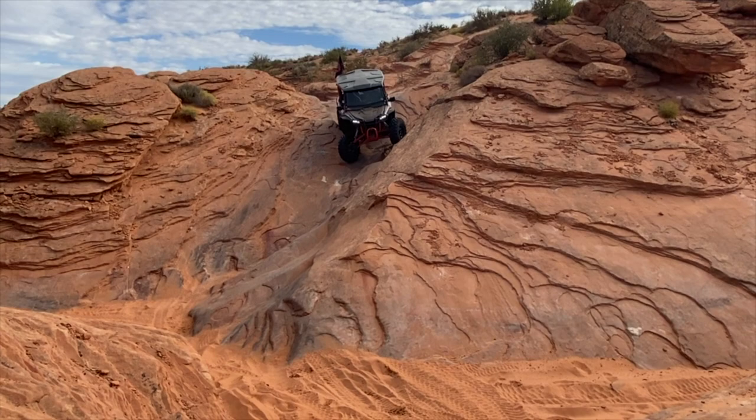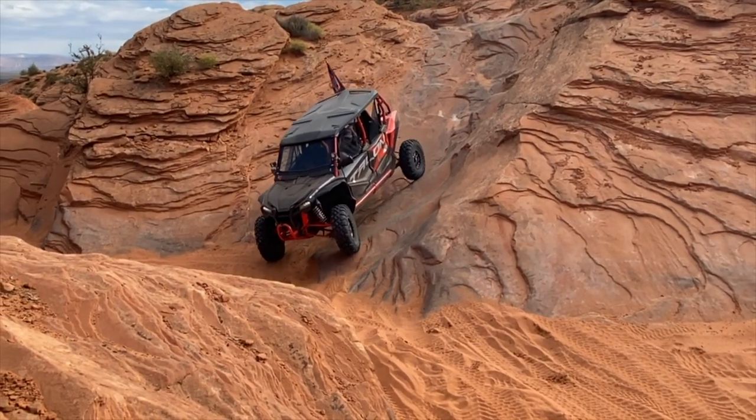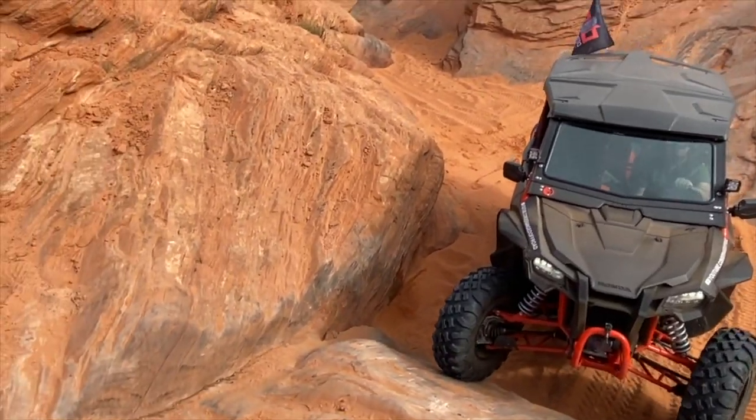So the size and shape of the tire — I want to cover that real quick. The size: they do run about the same as the Terabytes. They actually have the same carcass as your Terabytes do, so they're real similar sized and measured. When you fill them up to 15-18-20 psi, they get taller. When I initially measured them they were 31 and three-quarters — almost 32 inches at 20 psi. When I drop them down to about 8 psi, they are much smaller, shorter — 30.75 inches, not even 31 inches. So that helps with a couple things: with them being 32s on this Honda Talon, you do get a little scrub in the front; when you drop that pressure down there's a smaller tire, less rub.